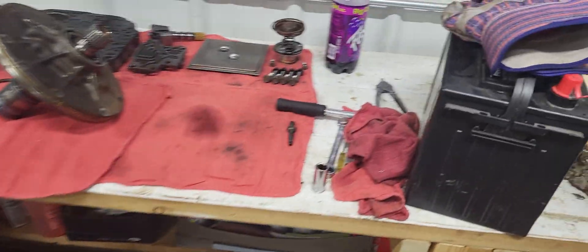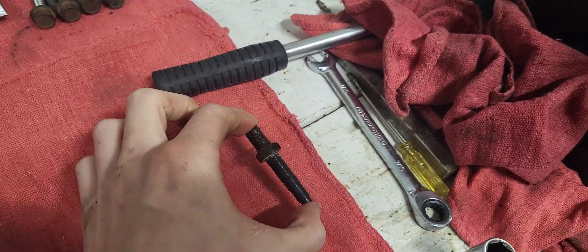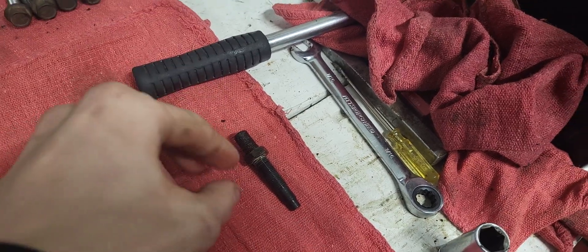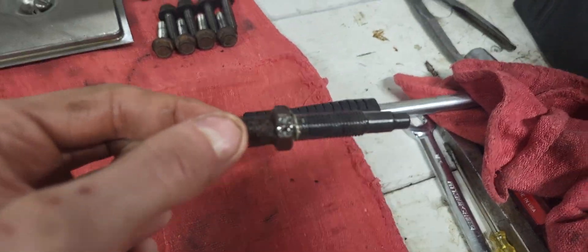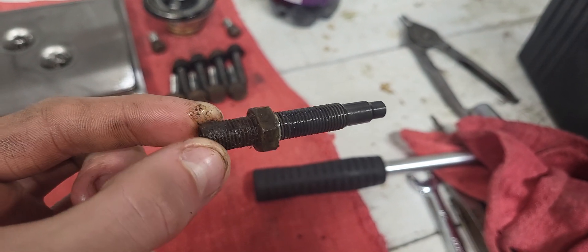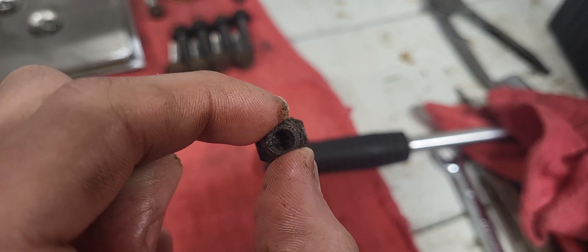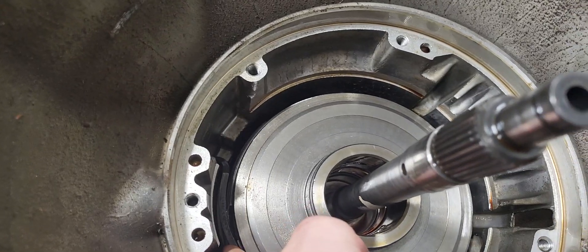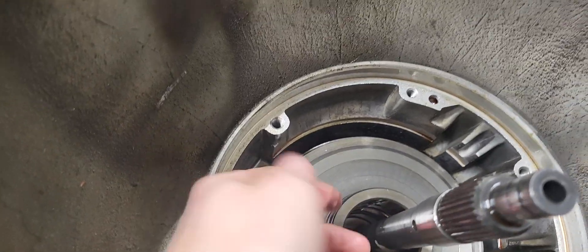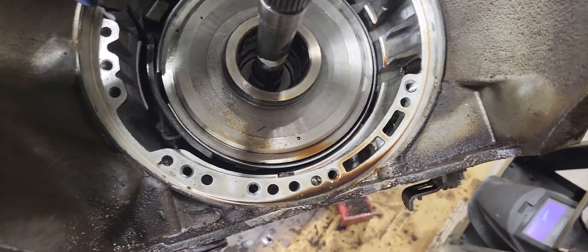I was a little wrong — it was actually 9/16, not a half inch, but close enough. We got lucky here: that nut is so rusted onto the bolt that it didn't come off separate, so when I put this back on all I've got to do is tighten it down to where this nut stays on the adjustment bolt. There's loctite on it so it's not going anywhere. But that's what the bolt looks like — without the rust you'd just stick your allen key in and pull it right out. Now there's nothing in the hole and the band is free. You want to get a needle nose and just pull it up and out of there, and the band just comes right off.